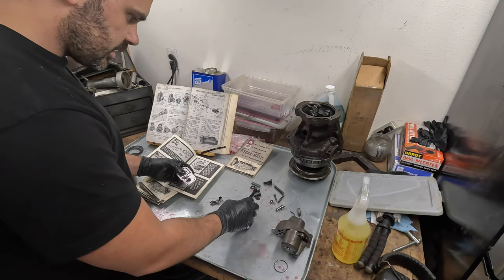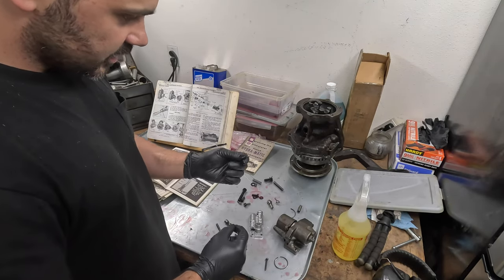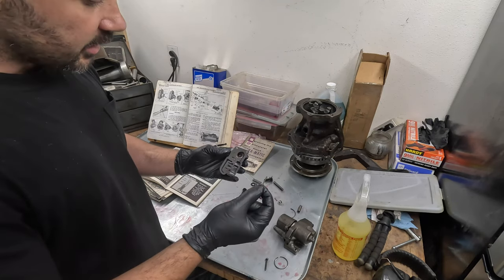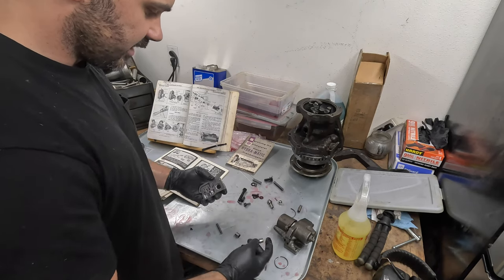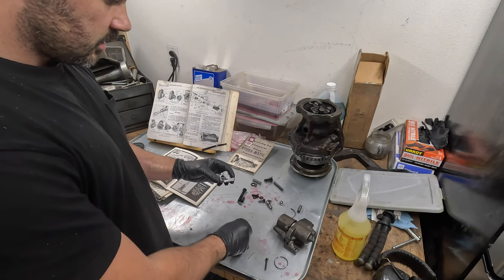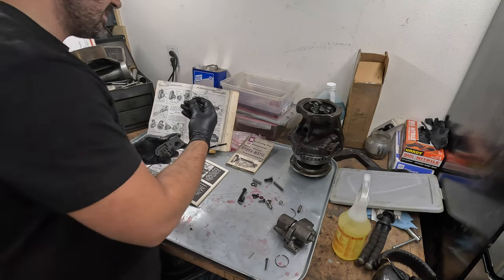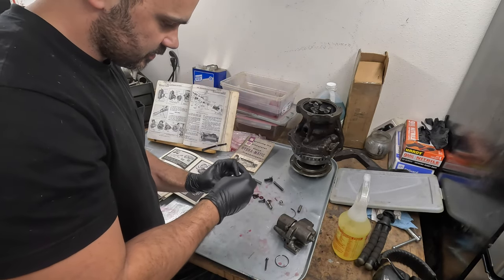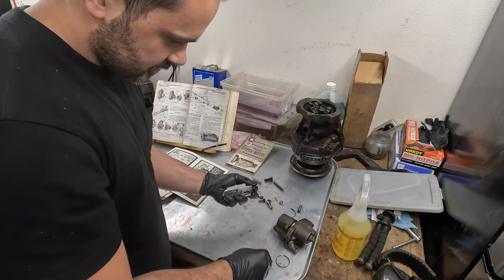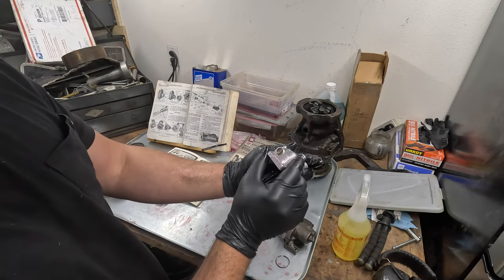This is simply a pin — which I don't have, but I know where it went. In typical fashion I lost the pin, but what I did was find an appropriate-size drill bit, cut it off, and this will work as our pin. Drill bits are hardened steel so it should work just fine. As the diagram says we just throw all of this together — this goes in here like this, and the spring plug goes in. It's spring-loaded obviously, so we push it in with this screw here and put our brand new oiled pin in. Fits nice and flush.